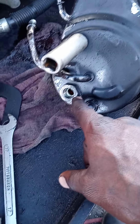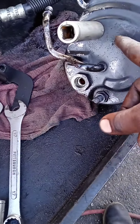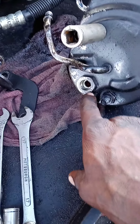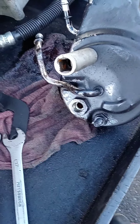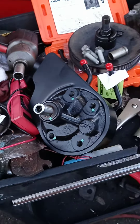Got a 15mm socket here on the front side. We'll get that off and then flip it over and show you what we got. So once you get these three bolts out of the bracket, take the pump off, flip the pump over, and remove the two 15mm bolts on the back.